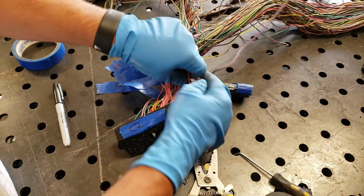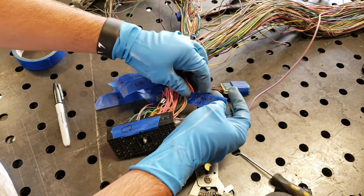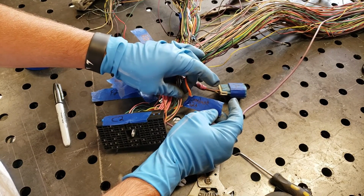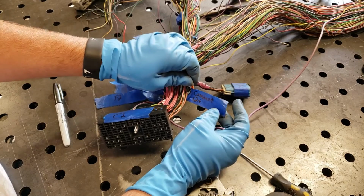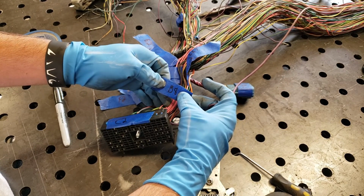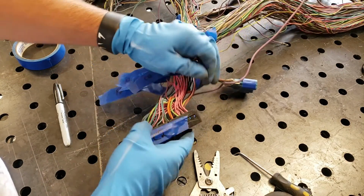First off, you got two wires. It's a constant 12 volt. They're orange. Most of the time, your constant 12 volt wires are going to be orange. Your key powered wires, your 12 volt keyed, are going to be pink. So, anyhow, constant 12 volt, that's going to be B8. And you're probably wondering, well, B8, what do you mean?